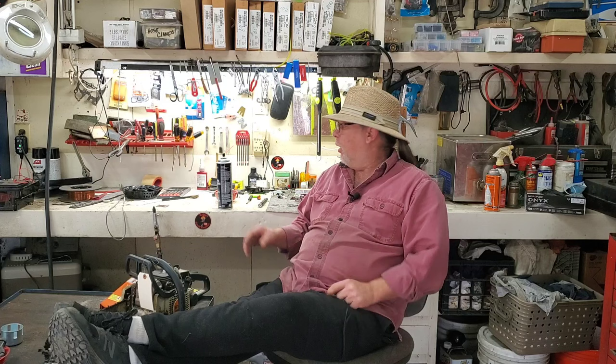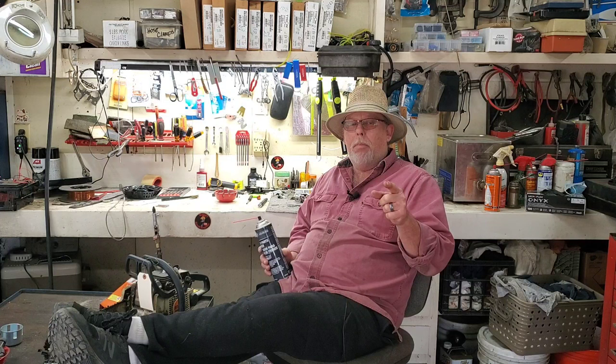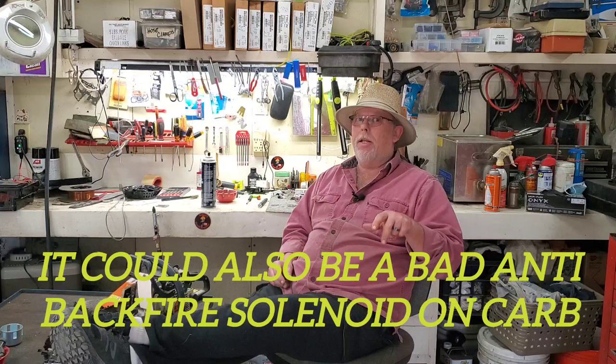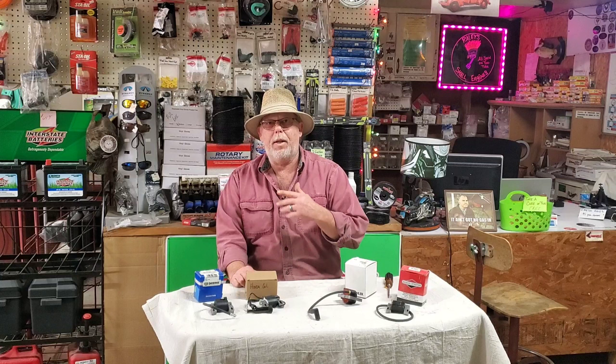Let's say the reason you're checking this is because your riding mower cuts off when it's hot. The fastest thing you can do — it was riding along fine, gets hot, shuts off — pop that air cleaner off, get you some brake cleaner, carb spray, or a little gas, pour a little squirt down into that carburetor. Try to start it. If it fires up, you've got a fuel issue. If it doesn't, then you go to checking the coil. That's a quick way to check it when they're cutting off hot. If you squirt that carb spray in and it does crank up, first thing I want you to do — let's say your tank is almost full — go loosen your gas cap. Could be the vented gas cap is stopped up or bad. Loosen your gas cap, let it sit for just a minute to give fuel time to get into that carburetor, try to fire it up, and see if it runs. That'll put you in the right direction also.